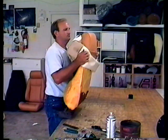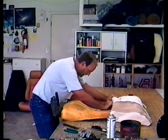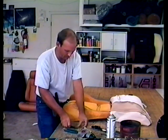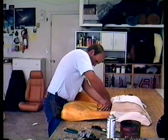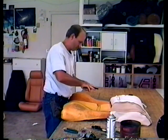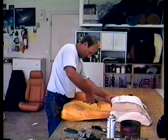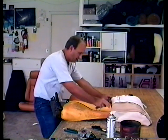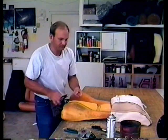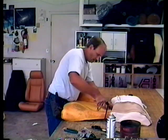Flip the seat back up without disturbing the headrest so you can see that first wire. Pull the headrest down a little bit and hog ring it on, just like Pontiac did. You can tell if the seat is centered by checking where the seams hit the foam down here — if it's on crooked, you'll have to take it apart and do it again.